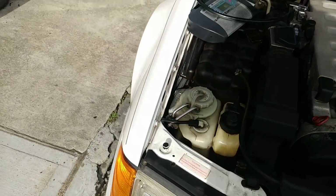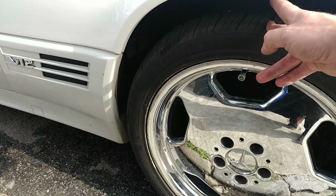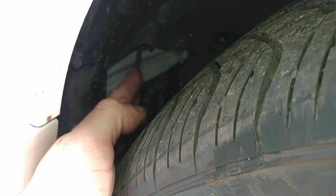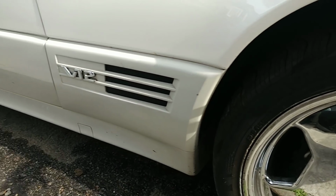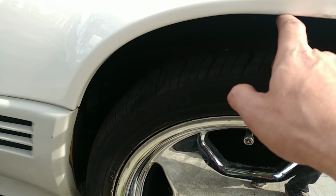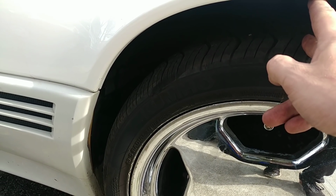And I will also show the suspension height later, because the suspension was low. The car was down very low previously, so as you can see, there's damage from rubbing, because it was totally down on its belly, and that's not good. And obviously here the damage is because of that. But rear and front now it's more or less level. I've raised it a little bit up front, so you have more room.